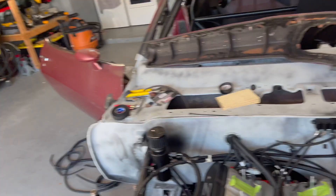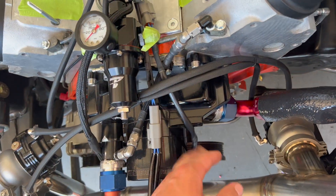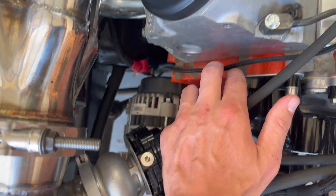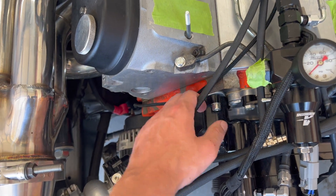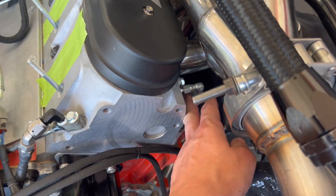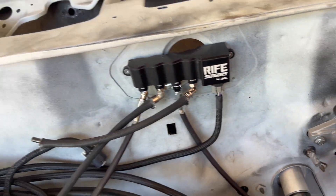It's been a few days since giving you a little update. The last portion of the video you just saw, the intake was still on and we still had a few things to finalize like the water pump, fans, and things like that. Over that time, we have the fans 100% wired, the water pump 100% wired, all of our boost control lines back on, our power tap wire for the alternator - the excite wire - our fuel pressure sensor, our coolant pressure sensor all buttoned up, and the Rife sensor wired. That's really nice.